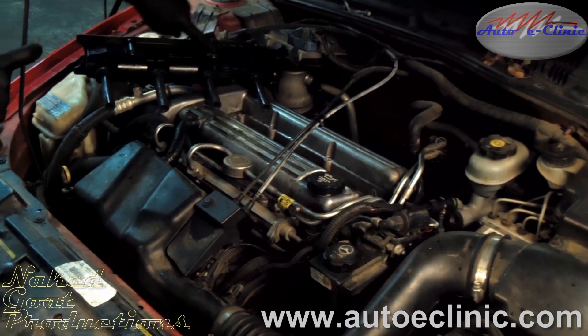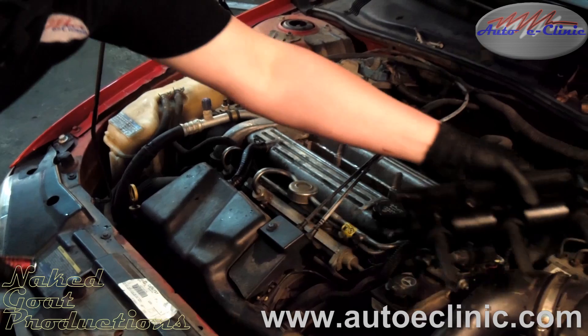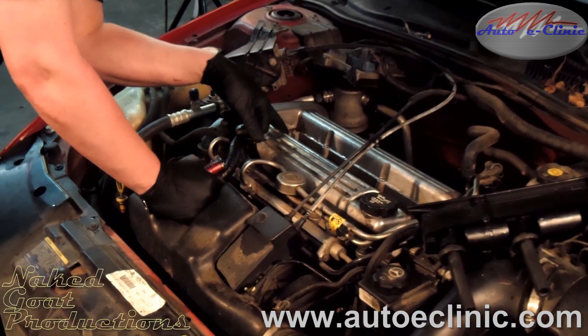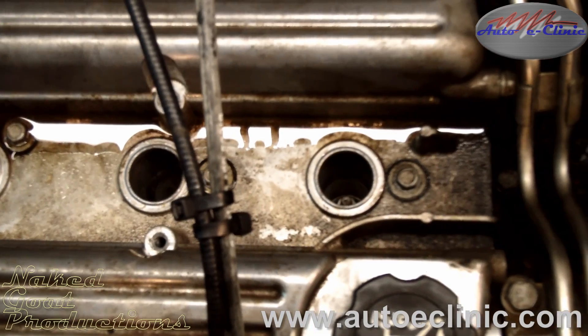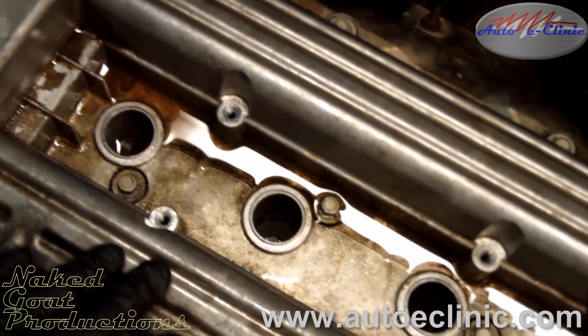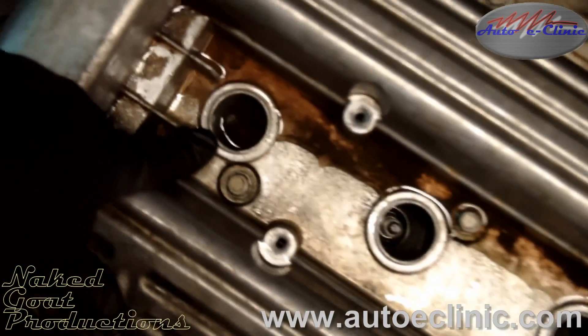You can see here, this entire assembly is covered in coolant. And if you look here, there's coolant in the spark plug holes and on top of the valve cover for that matter. The coolant is in the spark plug holes. The spark plugs are tight, the engine drove in here missing on one cylinder, but as the car sits, the spark plug holes fill up with coolant.